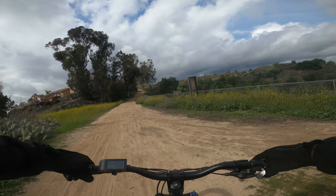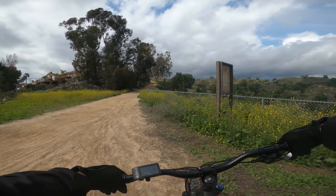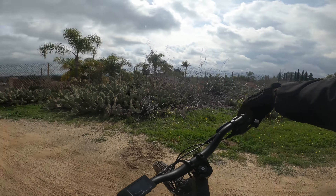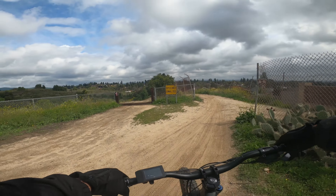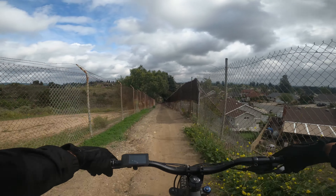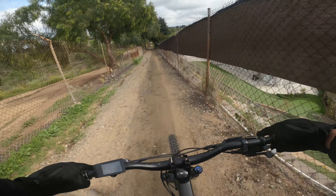We're back — got it running, but I can't shift down into smaller cogs and I can't shift up either, because I've hit the limit on my B-screw. So we're going to hobble it home like this.